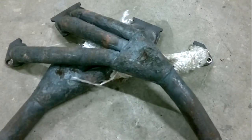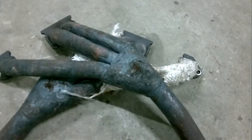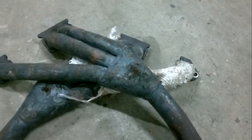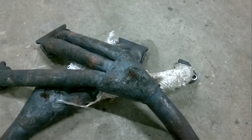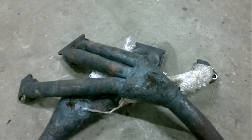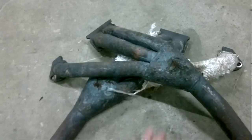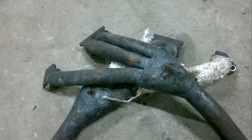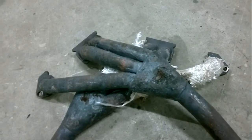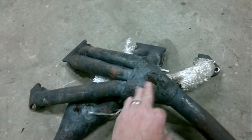This is the manifold off the car, and you can see the surface corrosion caused by the exhaust bandage. The condensation is created on start-up and again when it's cooling down once the engine is switched off, and it's quite severe, so it does attack the mild steel quite aggressively as you can see. This one's only done about 5,000 miles and the wrap has been fitted for a number of years, so it's been subject to quite a sustained attack in that short period of time that the engine's been running and switched off again.